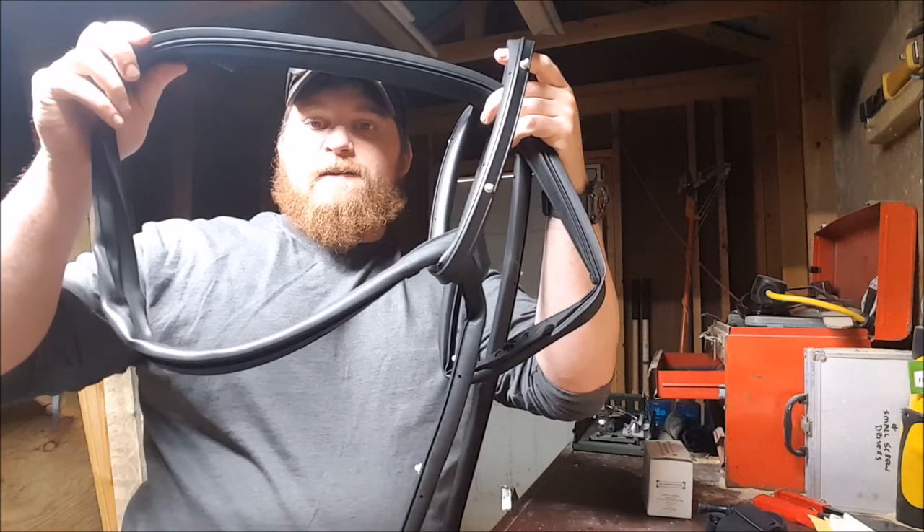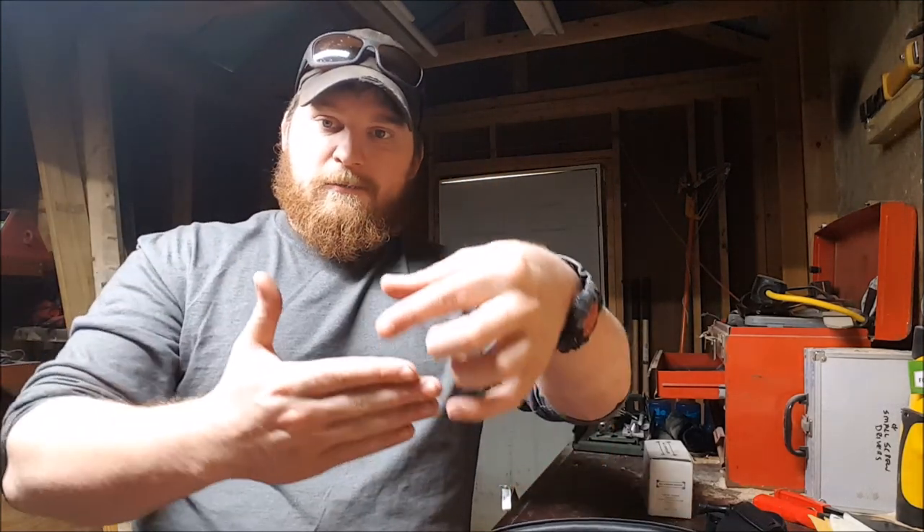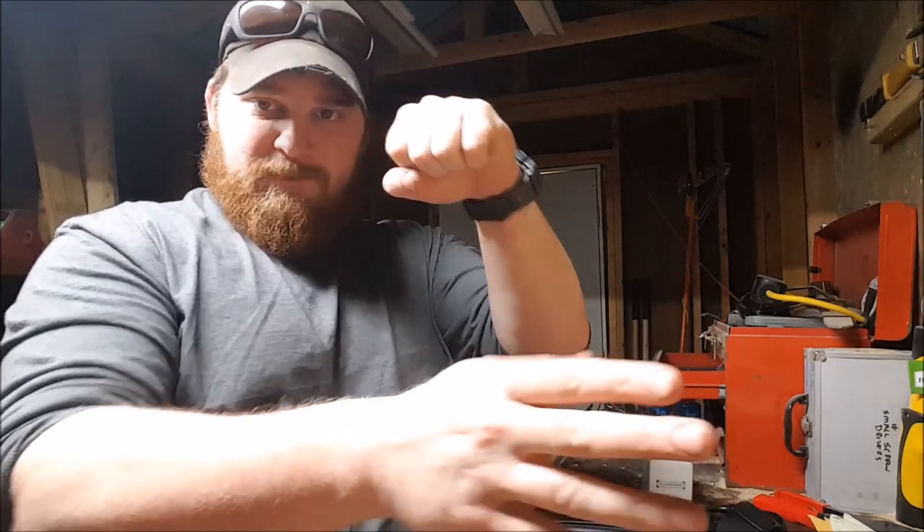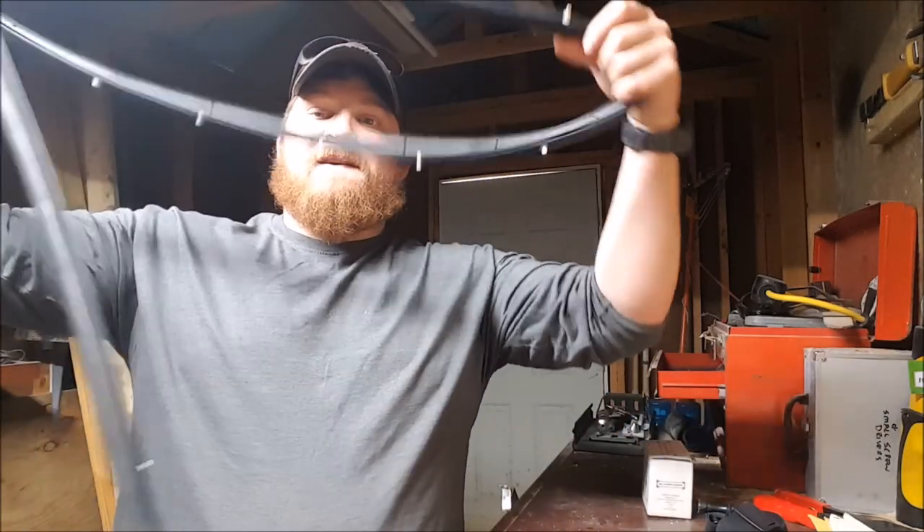I needed the weather stripping that goes on the inside of the window - when you roll your window up the window fits inside of that track and seals it from both ends. Mine started to fall apart a long time ago. I had to rip the door panel off and cut bits and pieces of it because it was bunching up, grabbing hold of the window, and keeping it from going up. I was afraid I was going to burn my window motor out. Now it's bunched up more and has dry-rotted spots, still catching the window when you try to roll it up. That's the piece I needed, but I ended up getting the whole outside weather stripping instead.